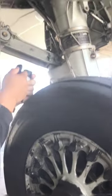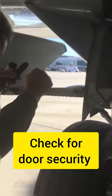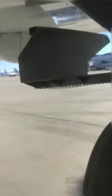Up here you want to make sure that nothing's leaking and everything is dry. We don't want anything loose — shake the door, that door should not move. This door is always prone to bird strikes, so make sure it's okay and nothing hit it. Continuing our walk around, we're going to inspect our engine lights. From here you can see if the lens is cracked; if they're not cracked, all we need to do is an operational check. Everything's secure, all the screws are in, the lens is not cracked.